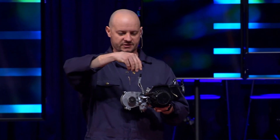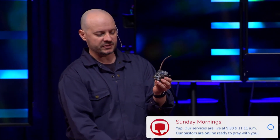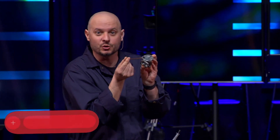I learned that with these little 47, 49 cc engines, when they've been sitting around for a long time, the main culprit for them not wanting to start usually has to do with a carburetor. The fuel tank sits here, this is the fuel line, it goes into the carburetor, and there is this little jet that the gas passes through — the opening is about the width of a tiny little needle, and it gets plugged up.